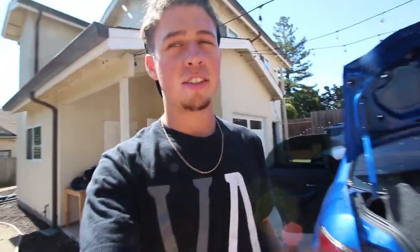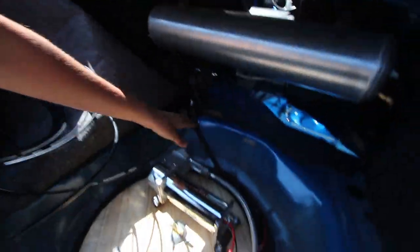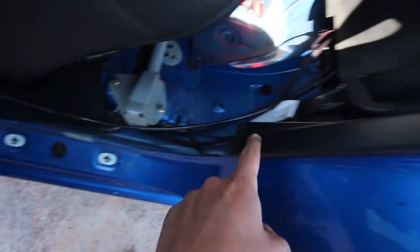What is going on guys? Today is the next day — day two of this bag install. I tried to get ahead of the game and set up before recording. All I've done since yesterday is remove this seat — four bolts, one on each corner — and take out the side rail to actually run the harness and run the lines. I've only done one line and the harness so far. I ran it through, gave it a little slack, straight all the way down, it's going to be under the carpet and then through a grommet.